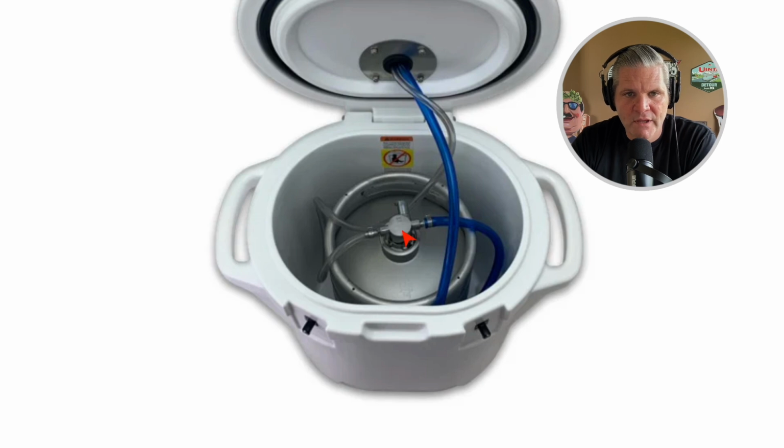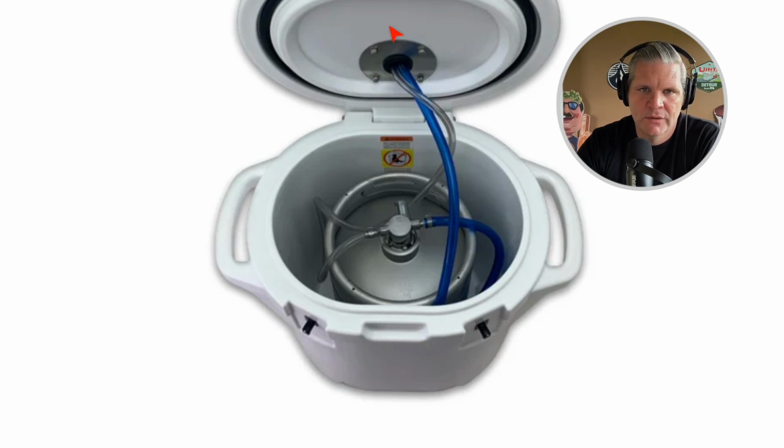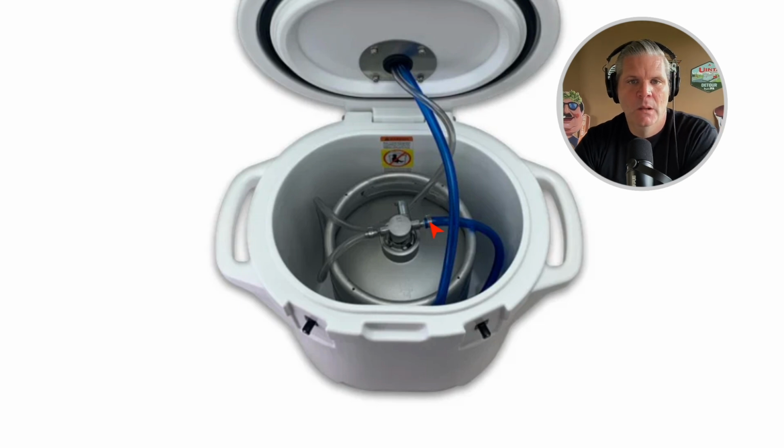These couplers are one of the top of the line couplers that we can get our hands on, right? We don't actually manufacture the couplers ourselves, but they're the best that we can get our hands on. I'm not guaranteeing that these can't fail, but these are very nice couplers. So I doubt that this is your issue, but my best guess is if you're having a leak, it's probably somewhere in the tubing. If you nicked it with a knife, or if this just isn't seated all the way, it can cause a leak. So it is possible. We just have to find it, right? It doesn't mean your system's broken. We have to find out where it is and fix it.